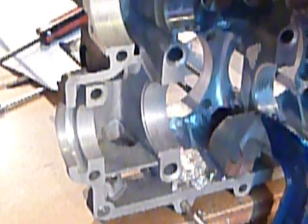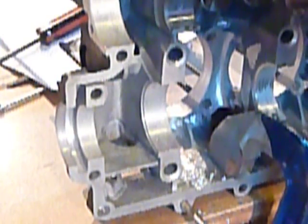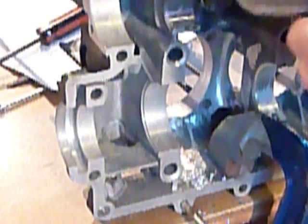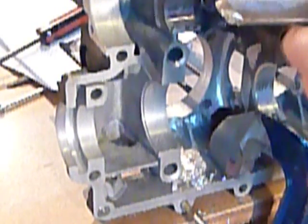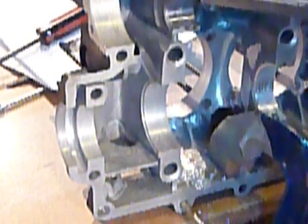If you don't have one of these, you can buy one at the hardware store, or you can take an old file and grind it a little bit just to make kind of a cutting tool. Aluminum is pretty soft, so I just think that's a little bit better way. Anyway, that's my tip for the day. I hope I get this engine running one of these days so I can get flying. Thanks for listening.